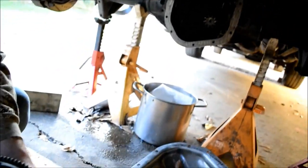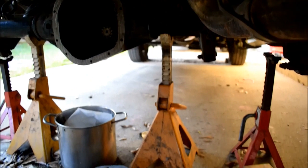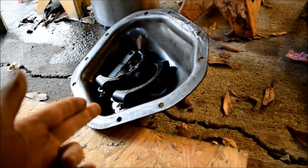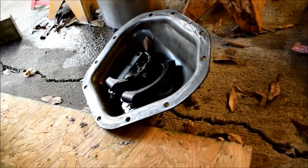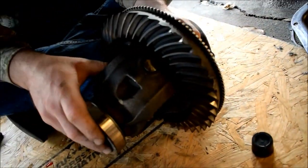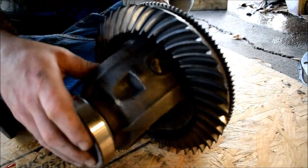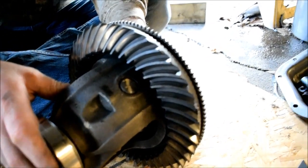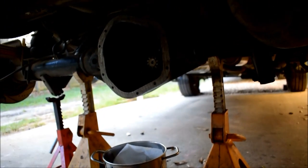All right. Next step, you put that thing in. True. But first, we gotta get our caps ready, though, right? What, our caps or our rear end cover? Just our caps. Well, I have our caps marked, so we don't actually need to do that. What we need to do is put the truck in neutral, because the drive shaft is still hooked up. The pinion's gotta spin and clap in, so we gotta spin it and push it into place.